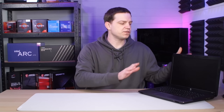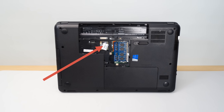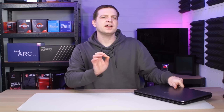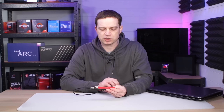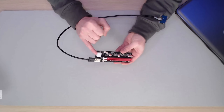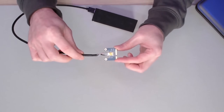To find out, we'll need some parts. Obviously we'll need the laptop, and there is a little bit of a requirement: it needs to have a mini PCI Express port. Most laptops come with these and they're usually filled with your Wi-Fi card, so you're probably going to have to remove that and use a wired connection instead. You'll also need a PCIe riser specifically built for laptops — it has a 16x PCI Express slot on a card with external power, and a small card that plugs into the mini PCIe slot.